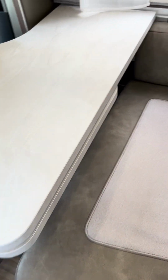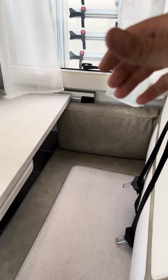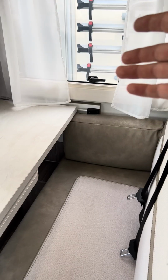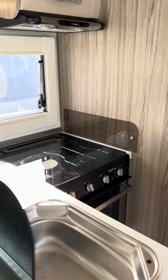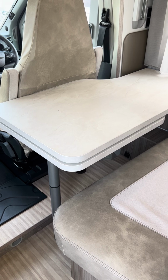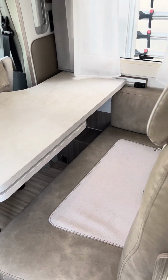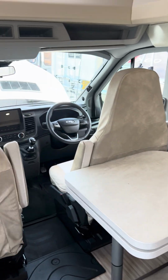You shouldn't ever really need to, well, eventually you'll need to, but it's less common to have to get to the fresh water drain off, which is why they don't always put it outside. Of course, when you finish your holiday, you should always drain your wastewater out, because it's going to be horrible and dirty water. But if you keep up to date with the fresh, if you just use it all up every time and put fresh water tablets in it, you shouldn't really have to drain it out that often. But that's the layout of the front just here.